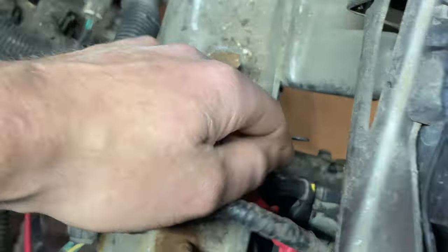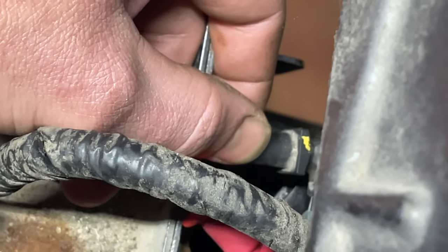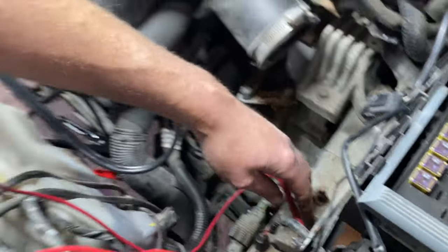As we've seen, this sensor is broken - it's wiggling, and it shouldn't be like that. What's happened is the seal is compromised and corrosion has gotten into those pins. I guarantee one pin will be broken. It needs a sensor.